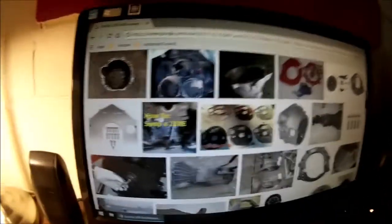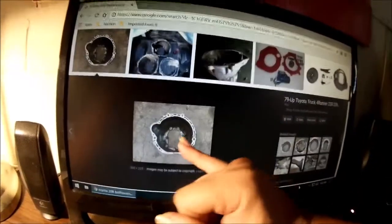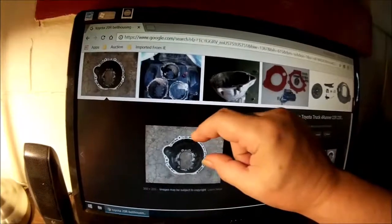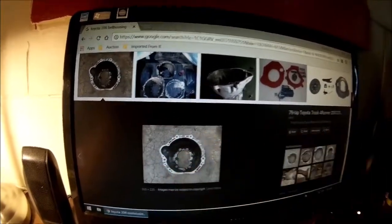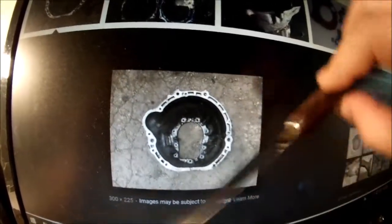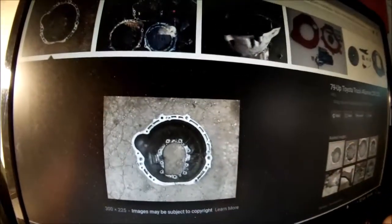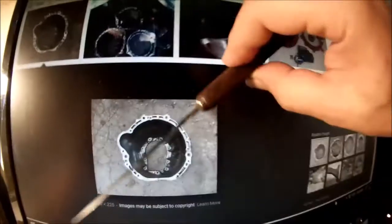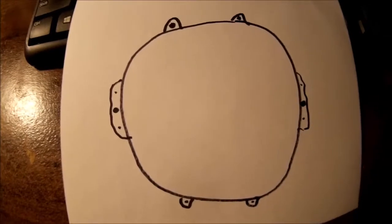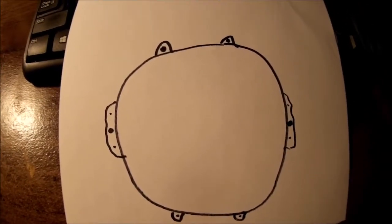But there you go. Just so you know, if you make those alignment pins, go on a diagonal angle. I wouldn't do these two or those two. I would do it like this. An angle like that, or like I did with it like that. Actually, I did do it like that because this is the other side. That's why we made this. That's looking in from the back side. That one and that one. That's where I had it. And like I said, it worked pretty good. They were right. The alignment pin thing worked pretty good. That's all I can tell you.